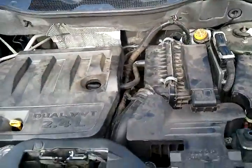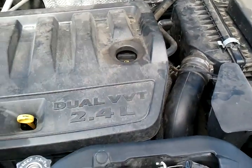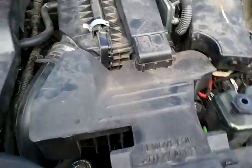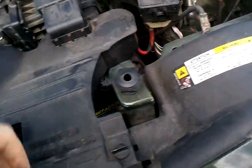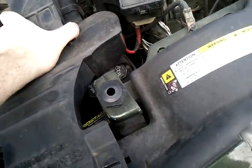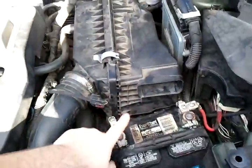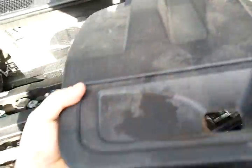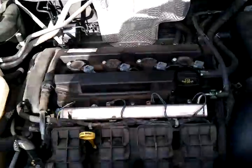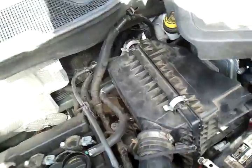Here's the engine. This is the bad sensor that I pulled out, and I'll show you how I got to it. You take off this air director here - it just directs the air in - you loosen these little screws here. I did it a little different than the manual but it helped. Then take off the negative battery cable and take off the engine cover.